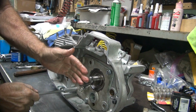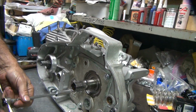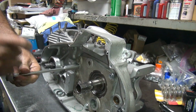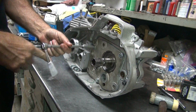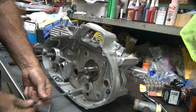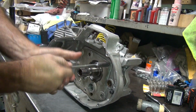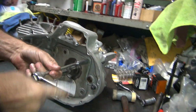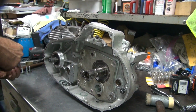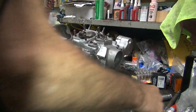If not, every time you push the clutch in, you burn up the thrust washer over there. If you're one of those yo-yos that holds the clutch in at the stoplight, because you're stupid, you'll burn that thing up before that light ever turns green. Yeah. This isn't a Jap bike. It's not made to run the clutch pulled in. No bike is. No vehicle is. Stupid riding schools think they don't know how to shift in a neutral. They probably have never heard of neutral. That's what they're for, you know. Power shift only. I don't think they know how to do that either.